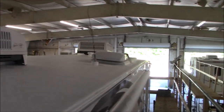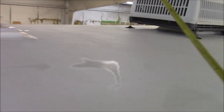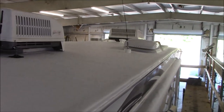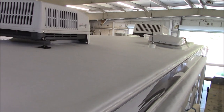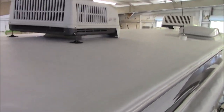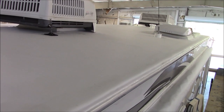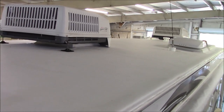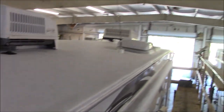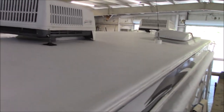We don't even offer any roof kits — maybe down the road we will, but right now it's going to be real hard for us to do that. The roof system is a 60-mil GAF grade structured membrane. This GAF is called EverGuard — it's the same roof system you'll find on a restaurant, an office building, a hospital. Same exact installation procedures — all we did is just kind of scale everything down. I designed these components so they work and function properly for an RV. But it's an exact replica of a commercial roof — it is a commercial roof.